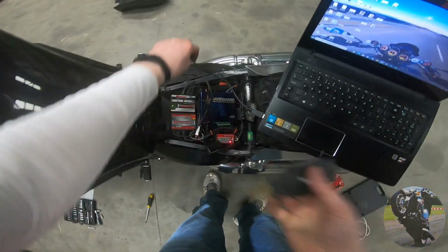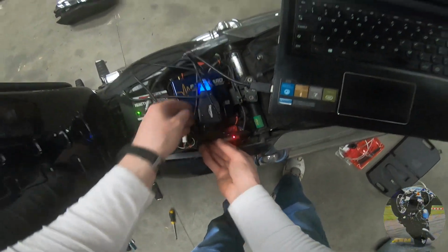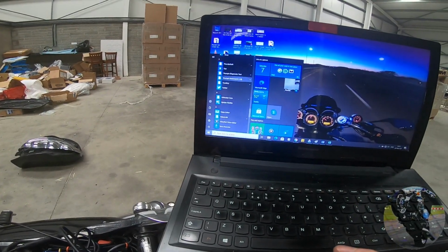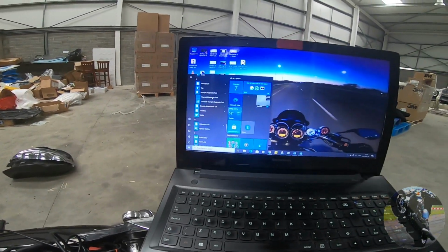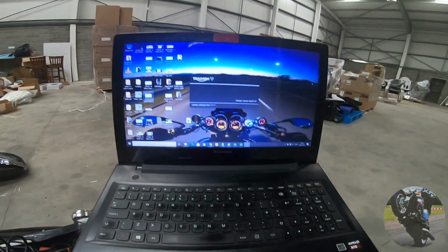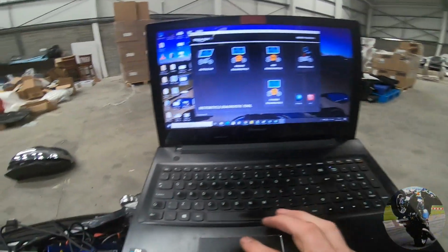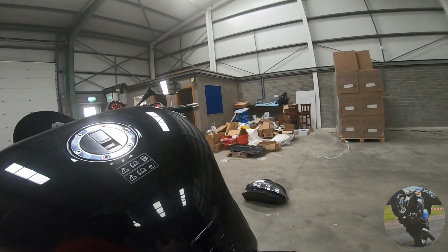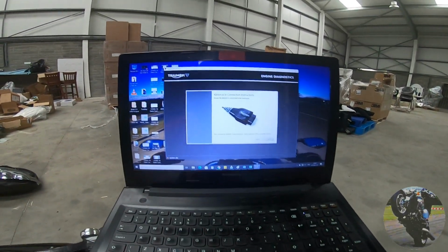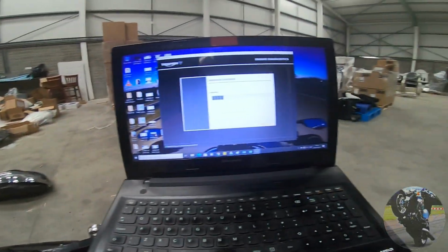So in we go, and in we go. There's the Triumph Diagnostic tool. Open up. Now Triumph is no better than TuneBoy or TuneECU. It also takes a minute to connect. So you can see now that I've had the engine running for a while, and okay, my throttles were pretty much close to balance anyway, so I didn't have to do a whole lot with them, but as you can see, you could be a while balancing your throttles and making all this noise.